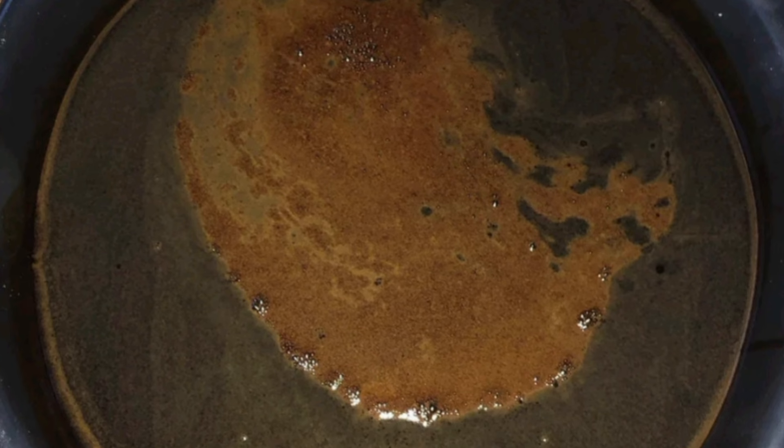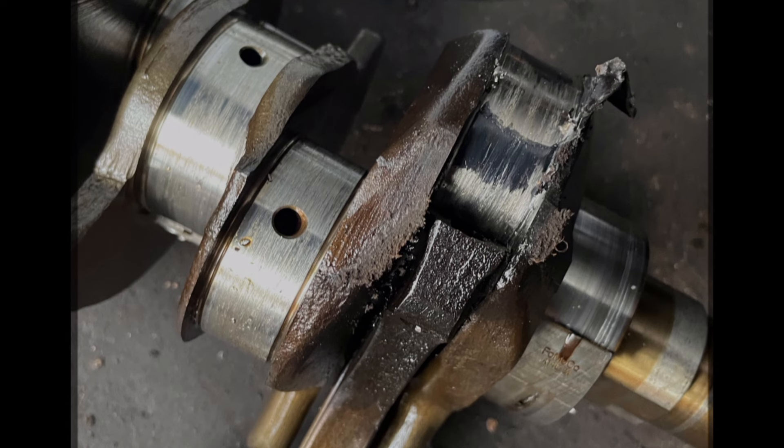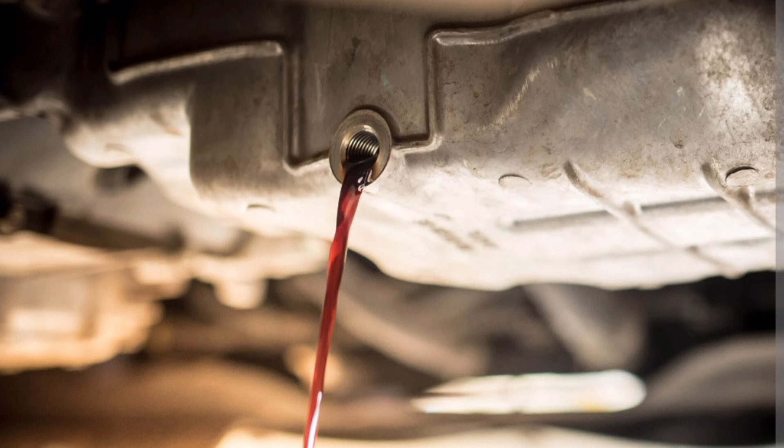This is very detrimental to your engine. When the oil is foaming, it reduces the viscosity of the oil and reduces the quality of that oil. It will cause havoc to your engine because it will increase the chances of crankshaft damage and bearing damage. The crankshaft bearings can be damaged because the oil is losing its lubricity. So what you have to do is drain and replace the oil, or reduce the volume of the oil so that the crankshaft will not be agitating the oil too much.